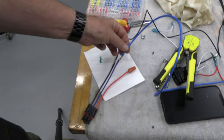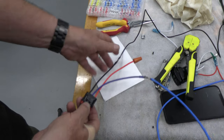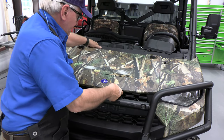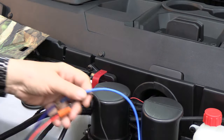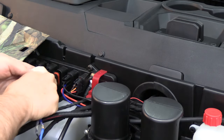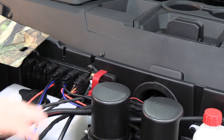I've done that already on this line. We're going to connect this three-part plug that goes into the pulse bar. We're not using continuous power — we're using switched power and ground. We'll take the hood off and disconnect these. Then we'll have access to the pulse bar, which is right here. Here at the pulse bar, we've got our quick connect. We're going to take this plug out and literally connect there, which gives us switched power — blue — and ground. Continuous power if we wanted it, but we don't need it for this application.